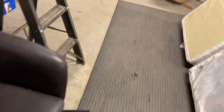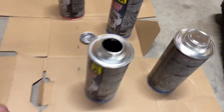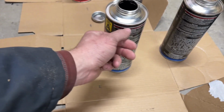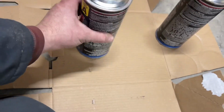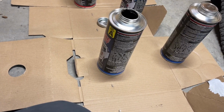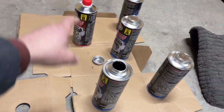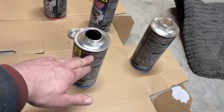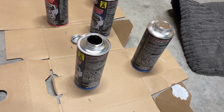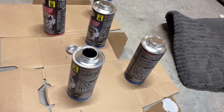So our spray instructions, I have it here so I can mix. You take the cap off of part A, the instructions say, and there's part B catalyst, go to this line right here. So it's down in there. It says exactly 250 milliliters. Honestly, I don't have anything, well I do, but it's food grade and I don't wanna use it to measure it properly. So we're just gonna pour that into there with a light and make sure we're close to that line and hope for the best. So we'll do that, shake it for a few minutes. It says two, but obviously we'll go a bit longer. And then we're gonna start to spray.